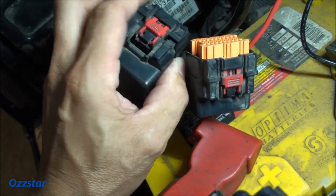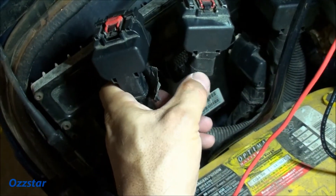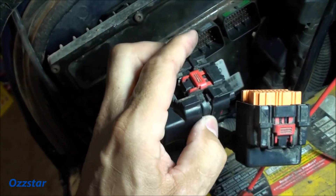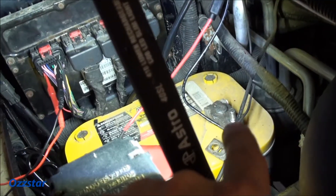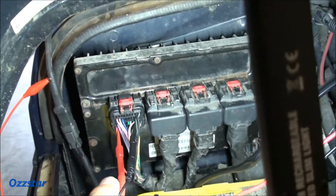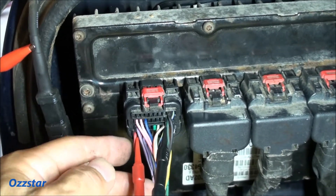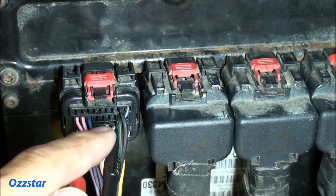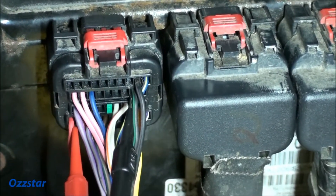There's tape around this area, so you'll have to remove that tape first. Let me slide this out — there we go. Now I've got access to that. I should have said from the start: disconnect the negative cable from your battery — that's number one. So right in here I back-probed the pin 29, which is this red wire. And pin 18 was our other one — that's this black with a green trace.